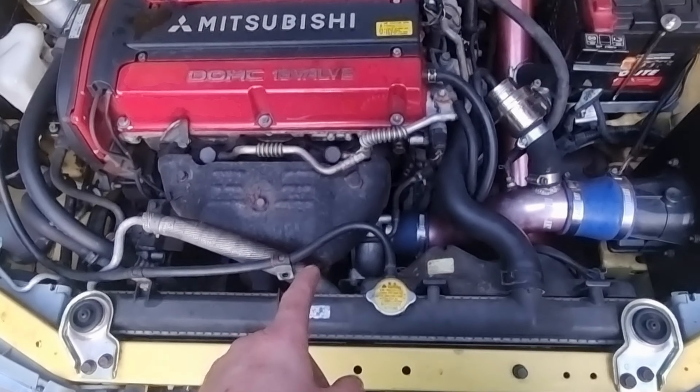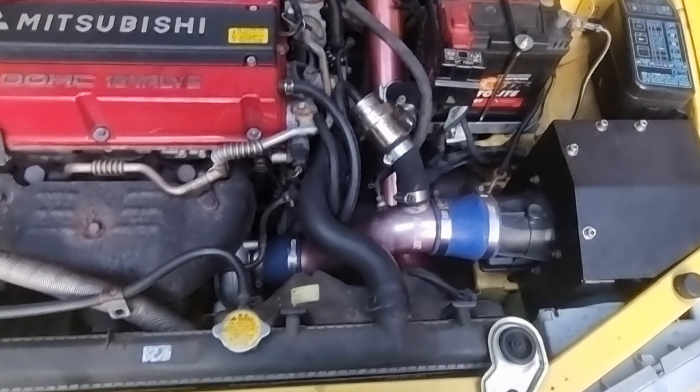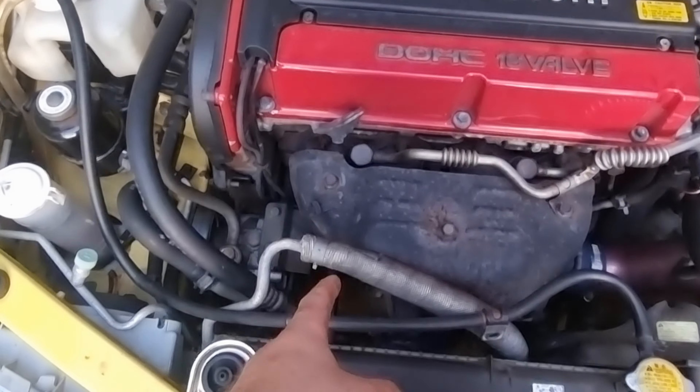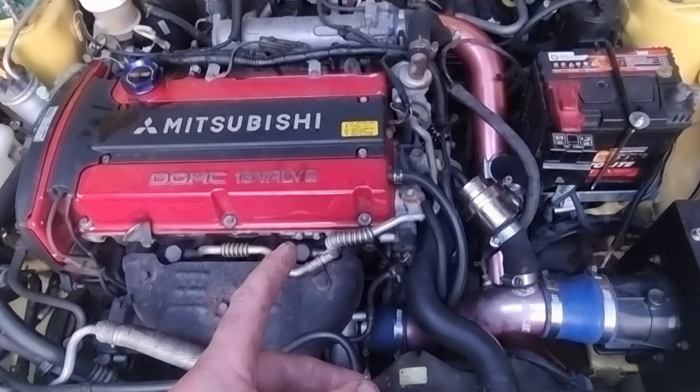To summarize after the run — it seems laggy and lean. The turbo timer's air-fuel ratio monitor is showing lean, so I need to get my wideband in the exhaust and have a look. We've just fitted the Gravity downpipe, and last episode we fitted the airbox, rally outlet pipework, intercooler, the Evo 8 turbo, and enlarged O2 housing. It seems more laggy but there's more top-end power, so I need to work on the bottom-end low-down torque.